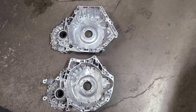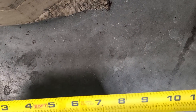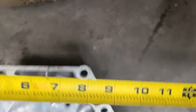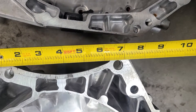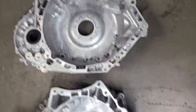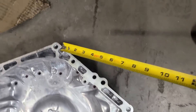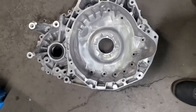One of the first questions I get asked is: can you bolt a turbo trans onto an NA block? At the top, the tube top bell housing bolts are about seven and a half inches on the turbo. On the NA you're under seven. The basic design is the same, but where the starter lines up, those bolts are not in the same location — these two here are different. So no, you can't.